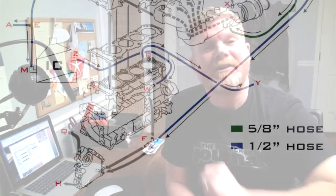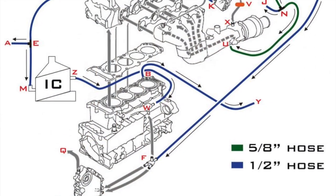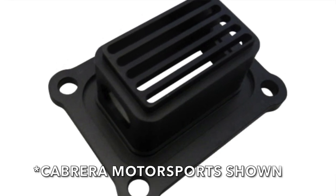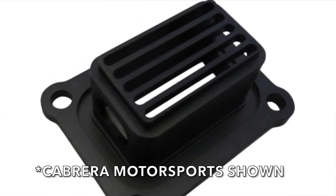A lot of people don't know what a stator is, but that sandy water is being pumped through your engine, through your intercooler, through your water box. Now, someone will say, 'Kevin, there's a filter on the stator — it's going to filter all that sand out.' Here's what that filter looks like. That's the Yamaha filter inside the stator. It's not a paper screen, it's not a wire screen — it is a piece of injection-molded plastic with a bunch of holes in it. The diameter of those holes? The same as this ballpoint pen.